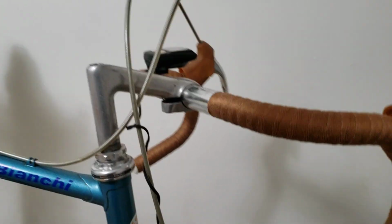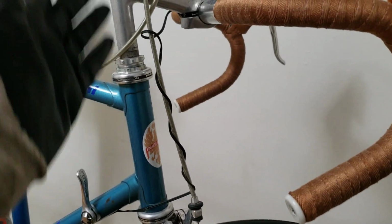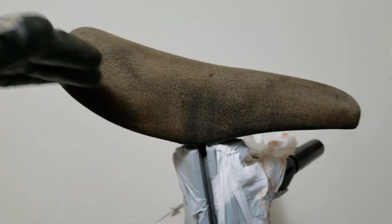So this is the front part of the bike. Speaking about the main part here, now I'm going to also take you across over here. I also check my saddle. I make sure that it's nice and tight. Sometimes the screw in here will be a little bit loose, right there. You want to check this bolt over here, which will align your saddle.